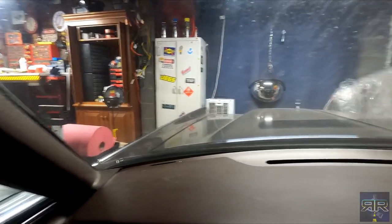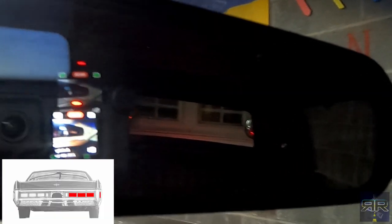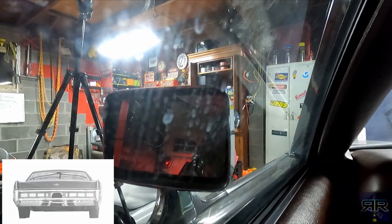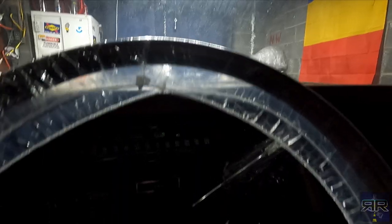Good girl. What we want to see, we're going to be looking at all our little mirrors. So first, marker lights, check. Side marker lights, I'll zoom in. And that one you can't see much, can you? In the mirror, you have 3 and 2, 1. And in this mirror, again, 3, and the side one is out. So we gotta replace the side marker light. All right, now brights. Just the 2 on those are good. Oh, yeah, we got another light that just burnt out. So we got a bunch of lights in the back. See the blinky blinky? Headlights.